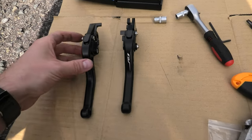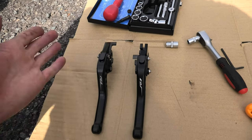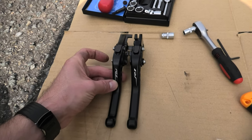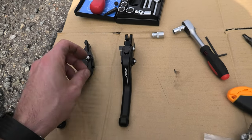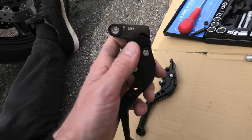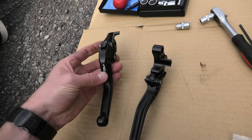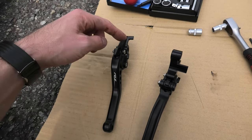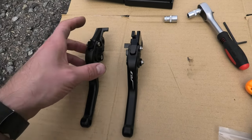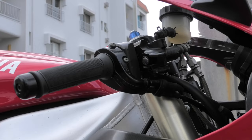What's annoying is I put the piece on that came with it in the bag - they're in two separate bags and they've mixed up the levers. I was looking at the logos and thought that's correct, so I picked up the one for the accelerator side, but it's the wrong piece. The clutch one is a bit thinner compared to the accelerator side. So I've put on the lever that was in the wrong bag - wasted a bit of time there. Watch out for that if you buy these cheap ones.